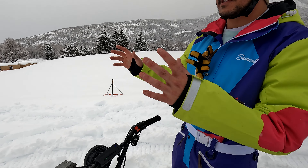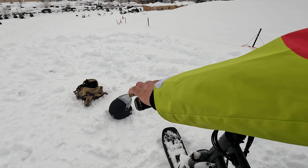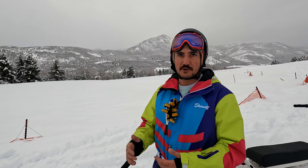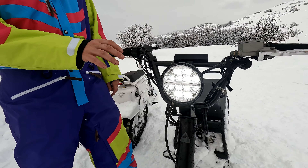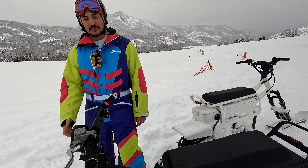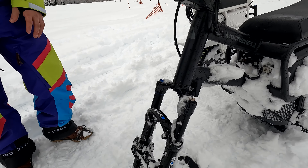As long as that key is turned, you can even turn the bike off and the battery will still continue to stay warm — great if you're keeping it outside while deciding where to go. The green LEDs show your battery life. There is a brake if you really need it, but because this is an electric motor, when you let go of the throttle there is regenerative braking — it slows down on its own. As long as the motor is turning without throttle, it'll actually regenerate a bit of energy back into the battery.